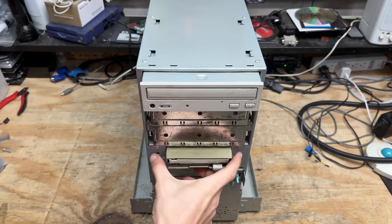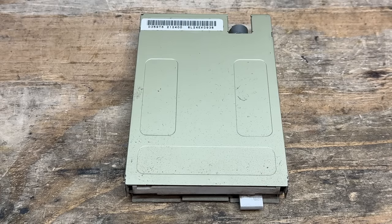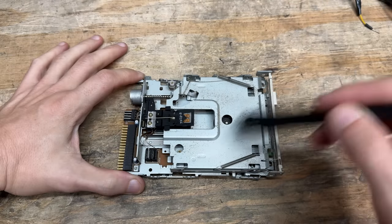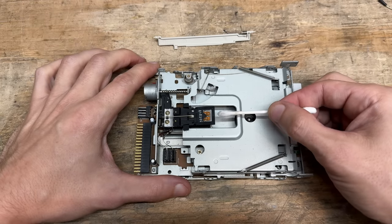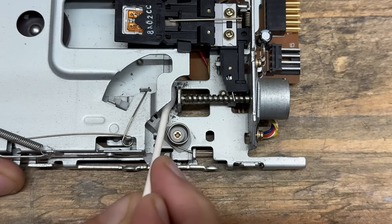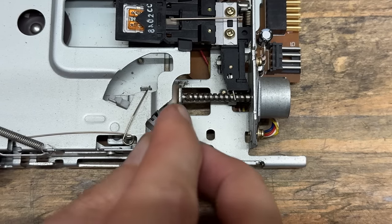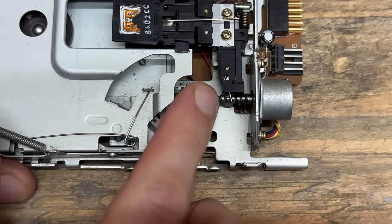Now let's check out those drives. And that's basically the same floppy drive as the previous systems, except much dirtier — though that's a D359T6, so they changed it up on us a little bit. Let's get it cleaned up. And yep, it's filthy. Those heads were a little dirty — better go over them again. There, that's more like it. This thing's kind of gross — some kind of corrosion slash petrified grease. I don't know how corrosion would happen in the presence of grease. Let's make sure that lead screw is not seized — no, it's fine.